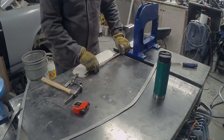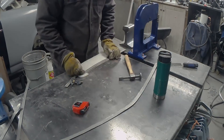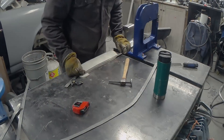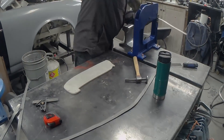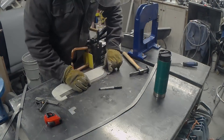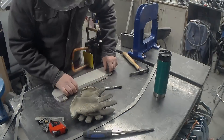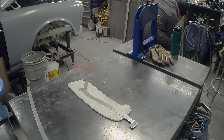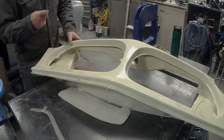My friend Matt has a car that has a front nose section that hasn't been crushed. So he made a wooden pattern for me, and I'm making a steel replicate of that pattern because it'll be a lot easier to use when I'm forming the front of that car doing the steel work. So I've got these templates made up and the old spot welder comes out — it's handy for this kind of template work where I'm just putting some stops in and getting things formed around. Then I noticed that front nose section just wouldn't fit.